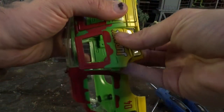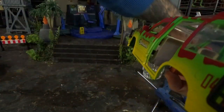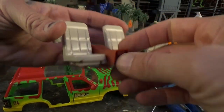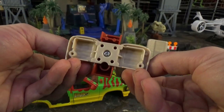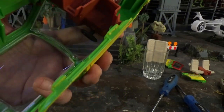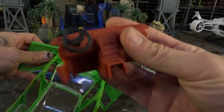You can take out your back doors so that they don't fall anywhere, and your two front doors. You can take this out too — you can actually leave this together unless you're going to paint the center console, but it comes out there if you want to do that. There are two screws up here that you're going to want to take out, and then this comes out. You can get your doors out.